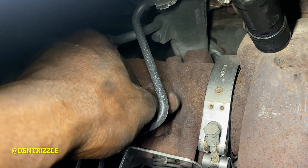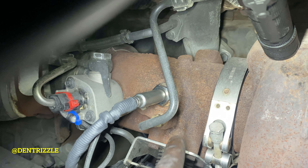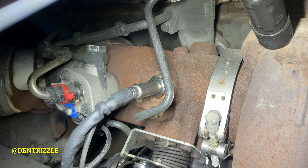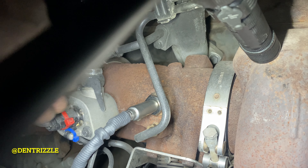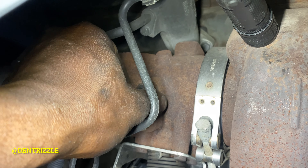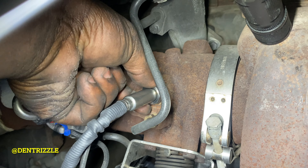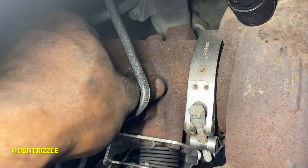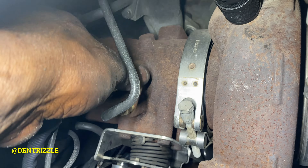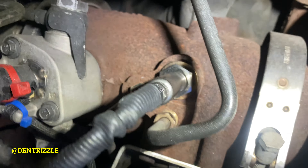What I did — I drove straight to the dealership and the DPF was already hot, so it made it easy to break loose. That's the advice I would give you: just get it hot enough where you can make it easier to break the bolt loose. If not, you can use a torch and heat it up. That's the unit right there.